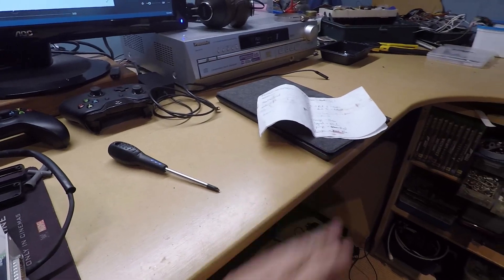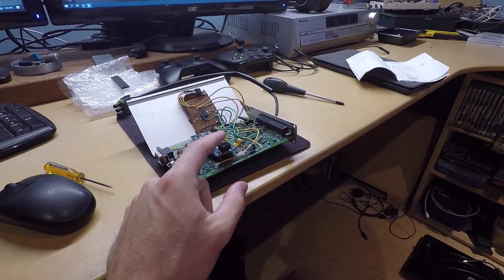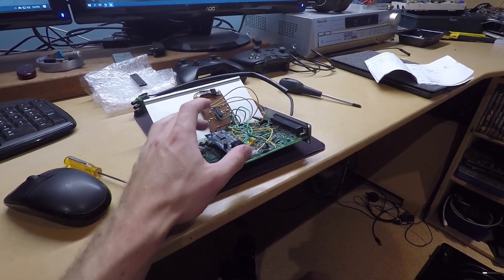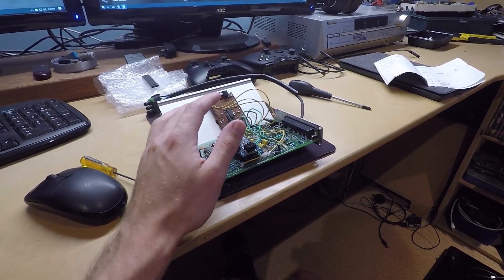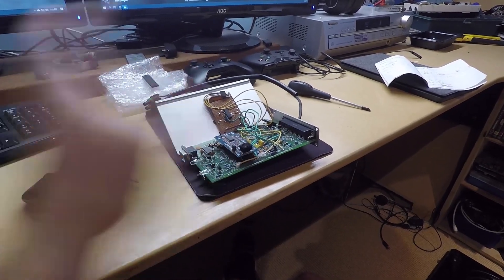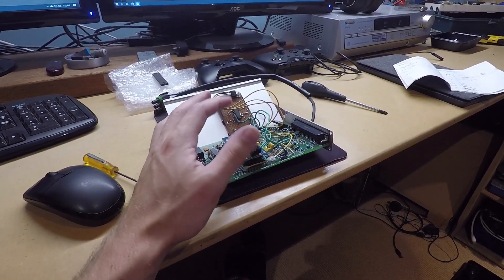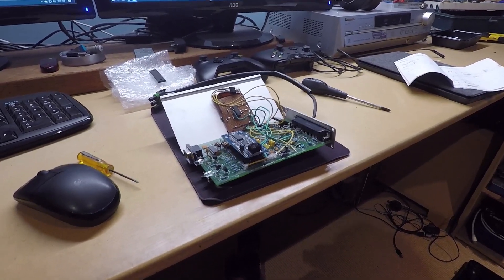I took a backup on the laptop of the current tune. I'll put this chip in, put it all back in the car, take the laptop out again, read what's on there, check what's on there, probably update the firmware because it's probably due for an update. Then I'll check it all back to default and bring up my other tune and copy everything across. I can export the map, so the map will stay the same — it just interpolates it a bit for the increased table size. Apart from that, it should all work in theory.